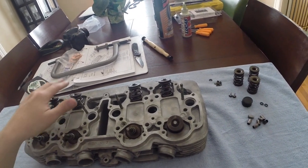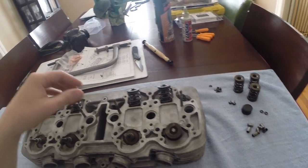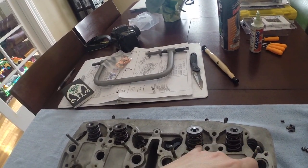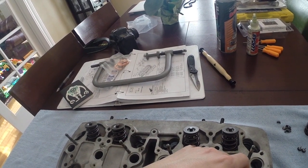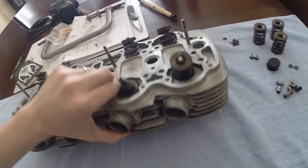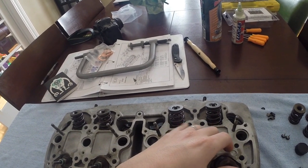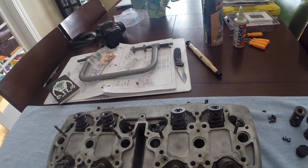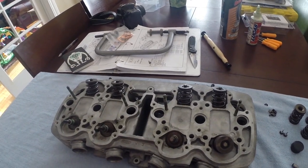I put on all the intake ones already because those valves were already lapped, because I had to take them over to the machine shop and replace the guides. I had to replace the guides. They're brand new guides that are in there because they were very loose. Just the intake side, just the hot side. The exhaust side was fine. That was within spec and that was okay.